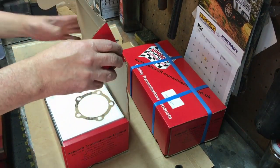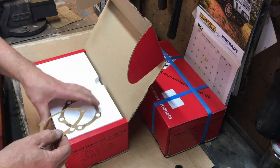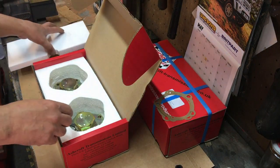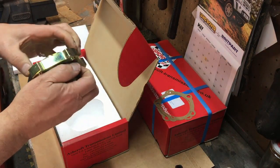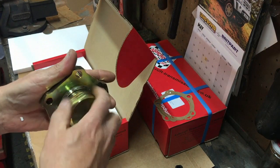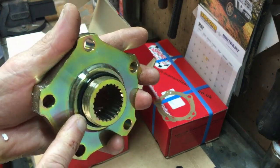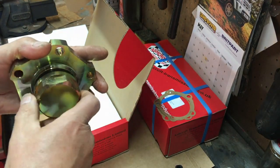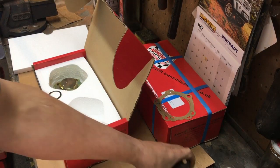Lovely packaging from Ashcroft, very carefully packed. First of all we've got a nice new pair of paper gaskets there, which is a nice touch - drop some Hylomar on them to get them to seal properly. And then in here we have got our beautifully made flanges. As you can see everything's all beautifully drilled, lovely plating on there. We've got a cap which screws on which feels like a pre-greased thread. We've got an O-ring in there to seal and keep all the water and muck out, and when we assemble it we can put a good handful of grease in there. Then we can put that cap on, nip it up with a spanner, and we're good to go - everything's nice and sealed, much better than the standard rubber cap.